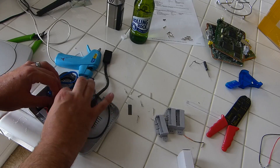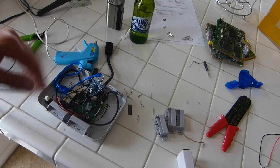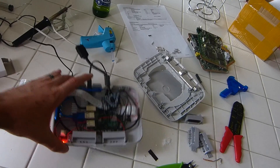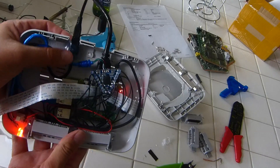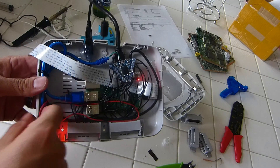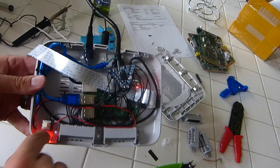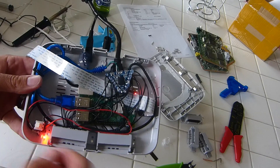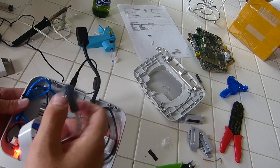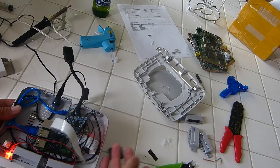I did get my LED in there as per the previous diagram and glued down my connection to keep it as flush as possible. With the LED light, there's a little circle underneath the power button that indicates where the LED goes, so you can glue that down. I need to put some electrical tape around the leads, but as long as you get it in that vicinity and not overlapping the screw hole, you'll be fine.